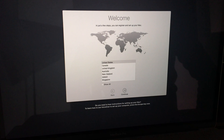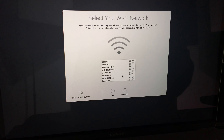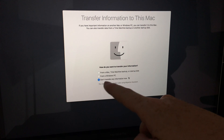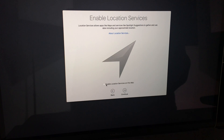After you see the Apple logos and loading bars, you should get to the point where it says Welcome — and you're pretty much done with the hard part. All you have to do is put in your standard setup information. Whether you're in the US, United Kingdom, Canada, or wherever, just select your country and continue. You'll need Wi-Fi to set this whole thing up. When asked about transferring data, since this is about setting up a brand new computer at factory settings, choose the option to not transfer any information.